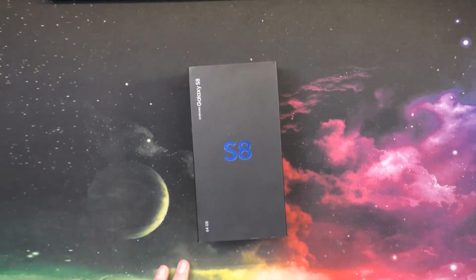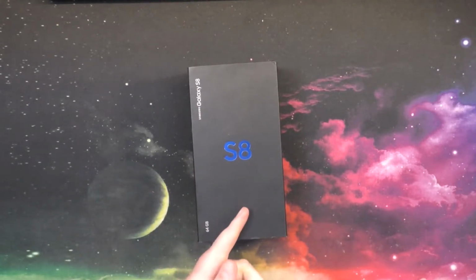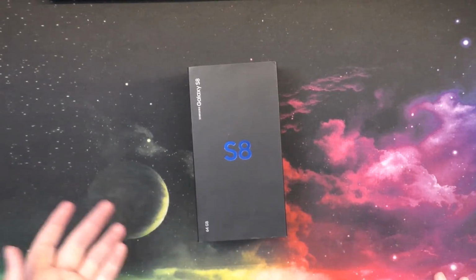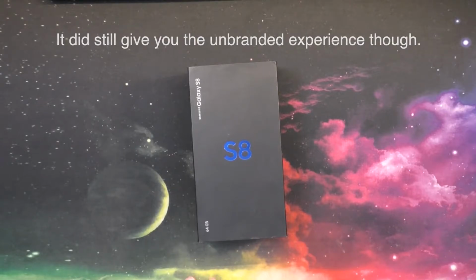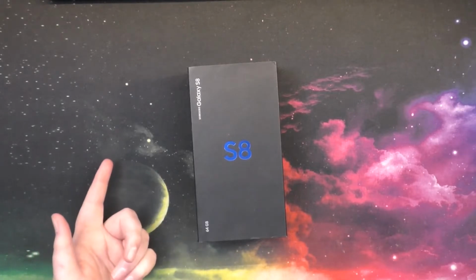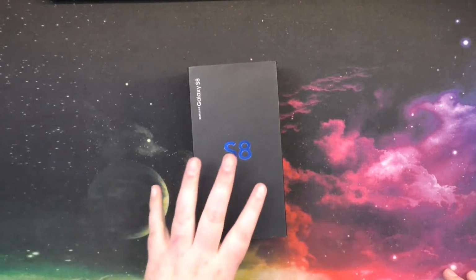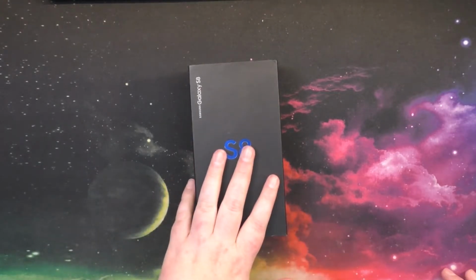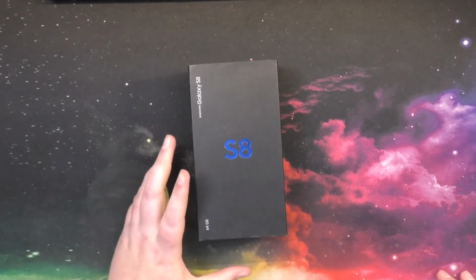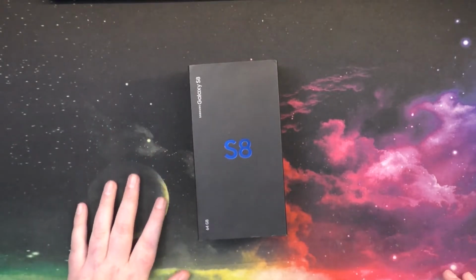And up until very recently, all throughout, you could still do the same loophole with the S8s. You could grab a carrier S8 that was unlocked. I mean, you could do it without having a SIM unlocked, but that would kind of kill the point of doing this modification. And you could flash with patched Odin, which is Samsung's firmware flashing utility, but it has to be patched to allow this, otherwise it'll just fail. But you could still just flash the U1 firmware onto a carrier S8, S9, going all the way up. And it would act as if you just bought the thing from Samsung, and it would work with every carrier, no matter what. Now we come back to the present.